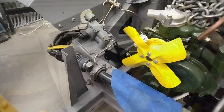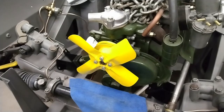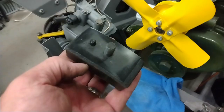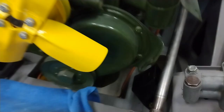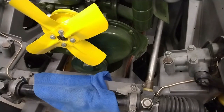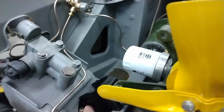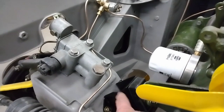I've just realized that I have the engine mount brackets on the wrong side of the car. So what I'm going to do is jack the engine up enough that I can switch these brackets out, flip them side for side, and then they'll be in the right orientation. I've got the brackets switched around side to side — it also means I have to turn these ones over as well because there's a little tab or dowel here that goes into the bolt hole. With the brackets installed the right way things went in a lot better. One other giveaway should have been this little notch in the bracket — it's there to clear the steering column. Of course there's no steering column on the right hand side on this car; this is a left hand drive, but you can see the steering shaft just clears that little cut-out there.